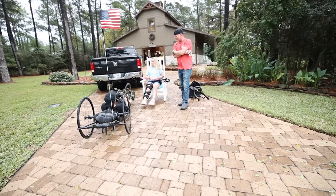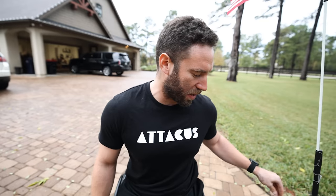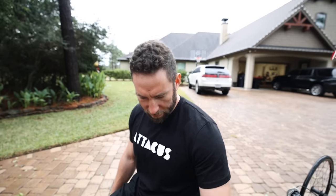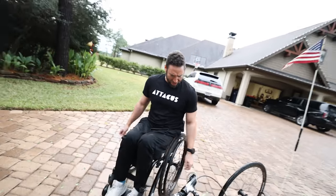Your legs really stop the steering from working. For tires, I went with Continental Gatorskins — the most durable tires I could find for this trip. It's difficult because there are not many tires available in this size, but these have worked really well. For spares we've got Schwalbe ones as the folding option to save on space. Considering all of the weight is on the front, they're looking pretty good — we've only had punctures on the front, and both times they were pinch punctures. They're also really easy to take on and off these rims.